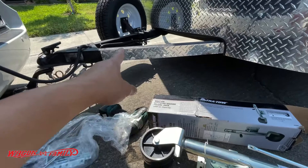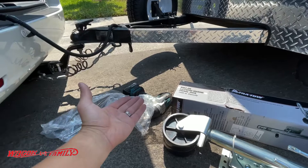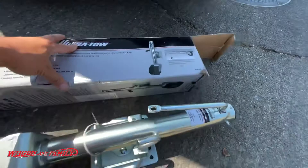One last thing about this particular setup on your trailer: you can mount it on the front of your frame and then swing it up as you're traveling, which is pretty nice. The stock jack came with a center triangle stand that goes straight down, but the problem is it hangs down quite a bit, so when you go over a speed bump it tends to drag. That's why I got a swivel jack — so we can get it up and out of the way.